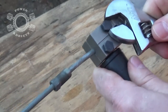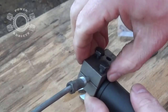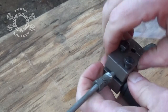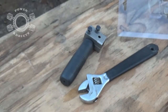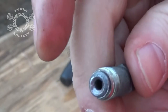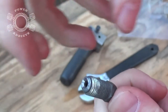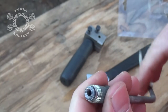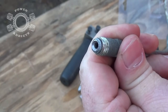Apparently I didn't eat my spinach this morning because I had to put a little oomph to break it loose! Look at that — whoo, pretty! Now we take the two clamping bolts out enough to pull the die apart, back them out, and pull it out. Let me wipe off the grease so you get a better view. And that right there is a beautiful double flare! You get that double thickness — it's going to give a good bite to your fittings on your brake lines, calipers, whatever. Much more safe, no line splitting. Double flare your brake lines — always, always, always. Heck, double flare your fuel lines too — you want no weak spots anywhere.